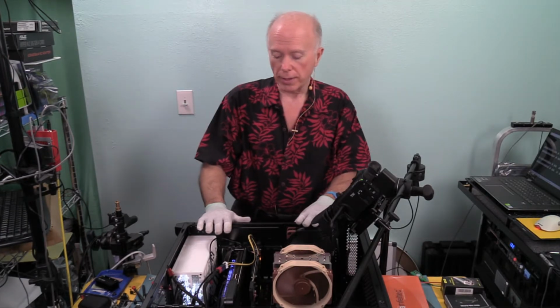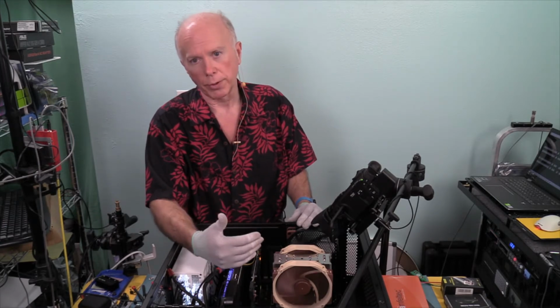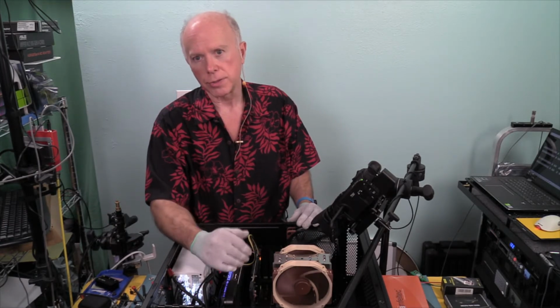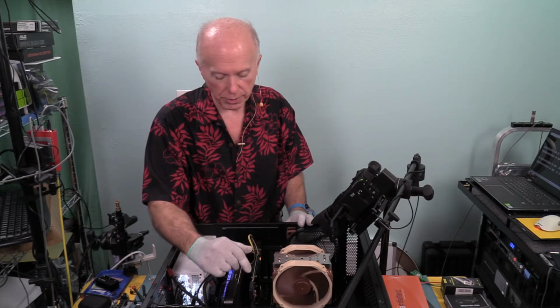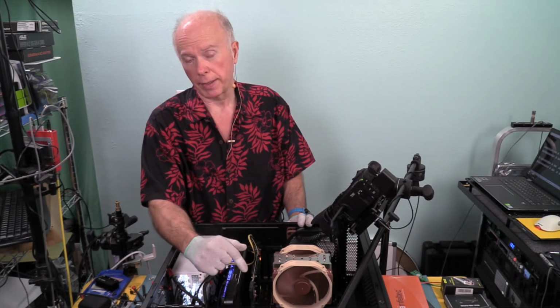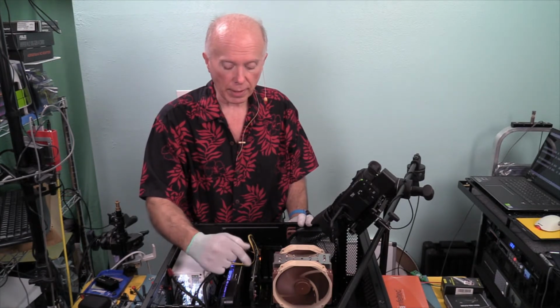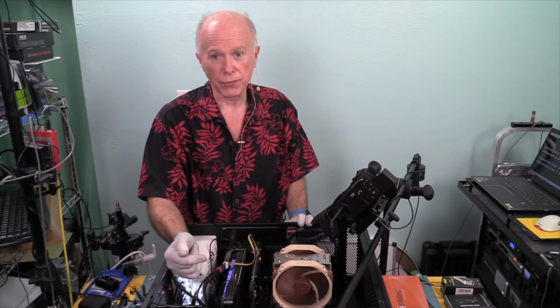My takeaway on this is, if you need to put 6 drives in a machine, and you've got a motherboard that has shared resources, this is the way to do it. The other option is to get a motherboard with dedicated resources, and if you're going to do that, go to a workstation. But for the technology and what this can achieve, this is phenomenal.